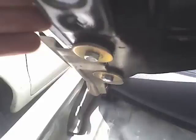First thing you need to do is that when you actually install the hood, don't immediately torque down these bolts. In fact, what am I saying? This is carbon fiber. Don't torque it at all. But what I mean to say is that before you actually snug it down, leave them a little bit loose so you can play around with the fitment of the hood. That'll be helpful once you decide where you actually want to mount your pins.